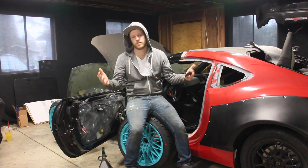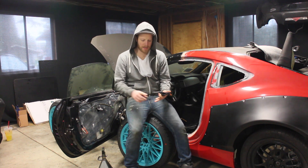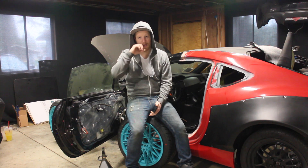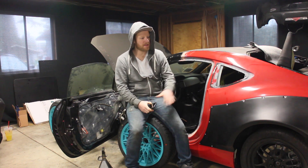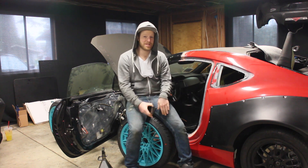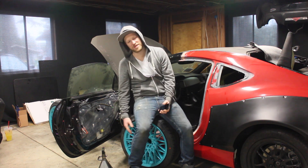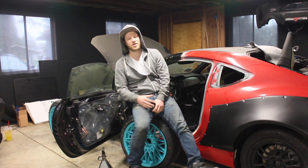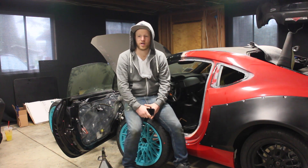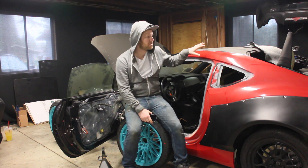These are the F23 model, 10.5 inch wide by 18. The guys over at F1R said these fit perfect with Rocket Bunny, so shoot me a set. We're going to film them and show you guys fitment, spacing, how the offset looks - they're a positive 20 offset. The next episode is going to be fitting the Rocket Bunny pieces on the front and rear bumper. I wanted that to be this episode but I didn't order lug nuts in time - they're getting in tomorrow. Today we've got a used front bumper with a crack to repair, interior stuff, and tuning stuff.